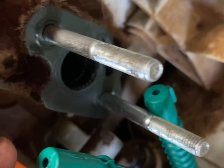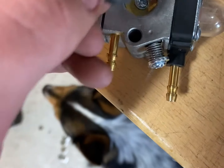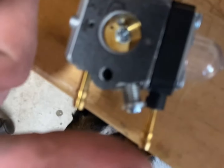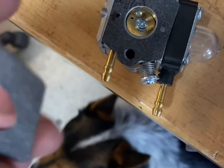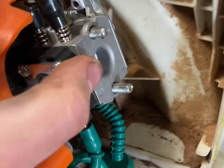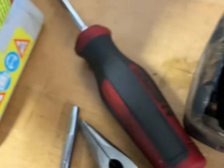You want to keep your gasket surfaces clean. You'll notice there's a hole in this intake on the engine side of the carburetor — you want to make sure you line the gasket up right and get it set on there correctly. These gaskets are kind of universal so they might have multiple holes in them. This one you just line up that hole and slide it on. The other one has no holes so that'll go on your air filter side. Then reconnect your fuel lines and throttle linkage.